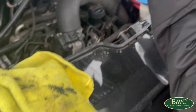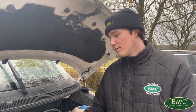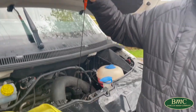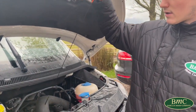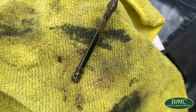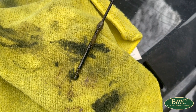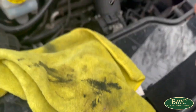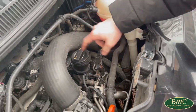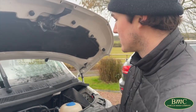I'm going to push that back in. You need to make sure that the engine has been turned off and cooled down for at least 10 minutes before you pull this out. So we're going to pull it out for the second time now, and we can see that the oil level is at the very maximum, so we do not need to put any oil in this car. But if we were needing to put some oil in, you would unscrew this cap right here — the one with the little oil can on it — and pour some fresh oil into there.